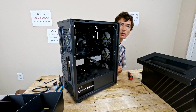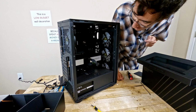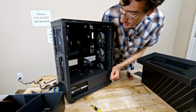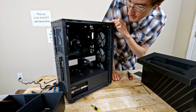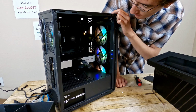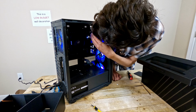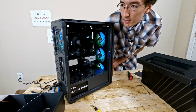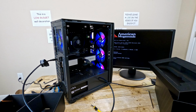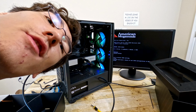As many of you who might build PCs probably already know, it's now time for the POST test. Well, that's a good sign. The aRGB behind the motherboard has come on, so let me press the power button and hopefully this doesn't explode. Okay, the hard drive's spinning, the fans are spinning. Okay, it's doing the checks. I'll connect the display and see if we can get anything displayed. Okay, good, we have display. Everything's working, so it's time for cable management.